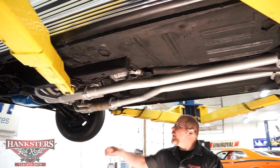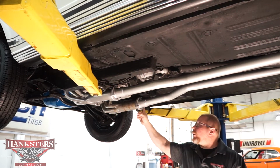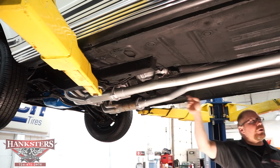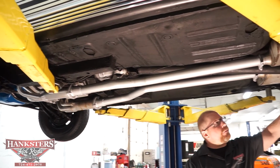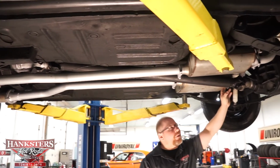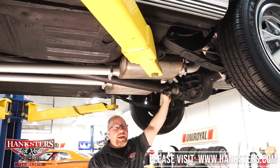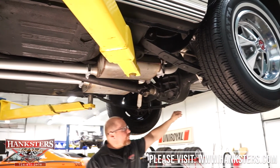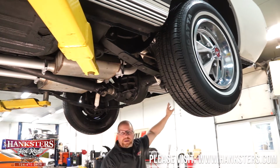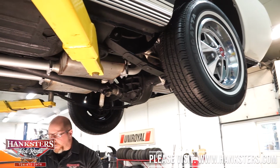So again, all of that's going to be in really good shape, based off the fact that the fuel tank's in good shape. And exhaust, that's going to be the next thing, and one of the last things that we go over here. We've got the long tube ceramic coat headers. We've got the dual exhaust all the way back, a set of dual V-force mufflers, probably like a turbo style muffler on this car. And then we've got the tailpipes that go up over top of the rear housing, and then those exit out through the rear lower valance on the car with a set of bell type exhaust tips back there. That is pretty much it for the underside.